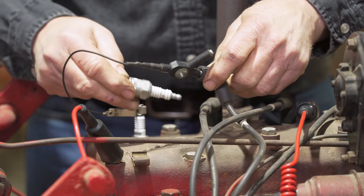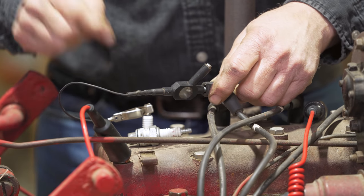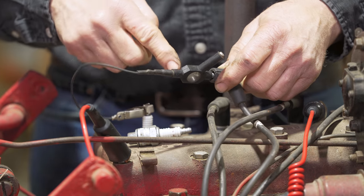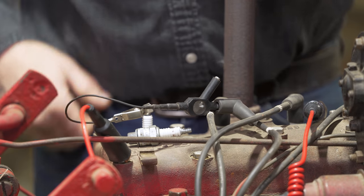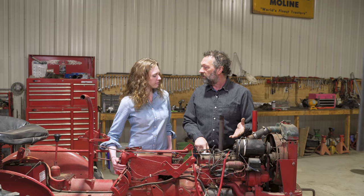Just simply put a spark plug on the wire, lay your spark plug on the head so that it grounds out, and then you can look at the spark — a healthy blue spark at the end of the spark plug. Rachel's going to roll it over and you can see in the window there, that baby's got a nice blue spark. So the spark has now traveled all the way through the system. Determine where you've lost spark. Possibly the spark plugs will be fouled out and that's where we'd head next. So we just want to do a quick bit of troubleshooting before you start throwing parts at it.